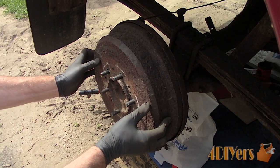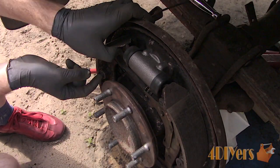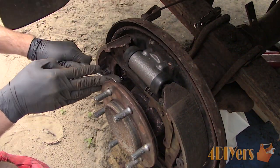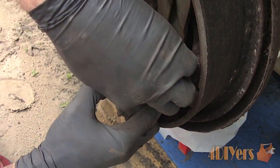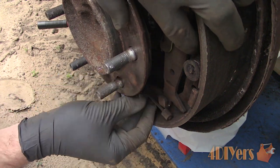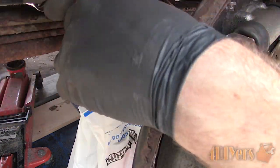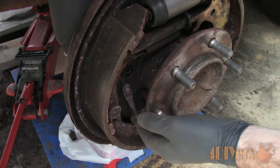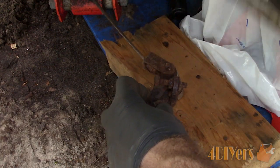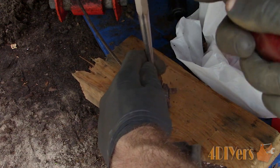Moving on to the opposite side, again using the same process, remove the brake drum. Remove the two 10mm bolts. A quarter drive ratchet may even be small enough to work in this situation. Make sure you don't lose that little metal plate if yours still has it. Pull the brake lever back to disconnect the cable that runs along the bottom. Unclip the cable on the opposite side to completely remove. Disconnect the spring on the rear using pliers. Finally remove the bell crank by disconnecting the mechanism on the inside. Again, remove the seized pin using the socket and a hammer. A punch may also be required to completely push it out.